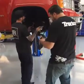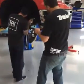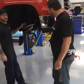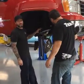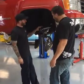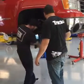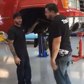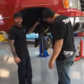Right. So we did have one question here, Jeremy. When these ball joints wear out, or if they do wear out, is there a way to install the factory Chevy ball joints on these particular control arms? No, they're pressed in from the factory. Lowers are pressed in, but you can buy the replacement ones from NAPA. Upper ones are bolted in, lower ones are pressed in, and you buy all this stuff right from NAPA.